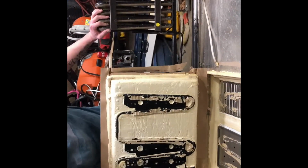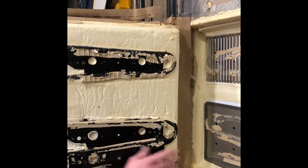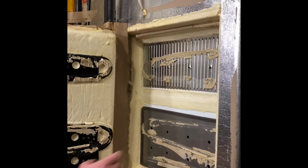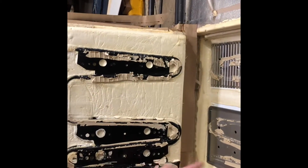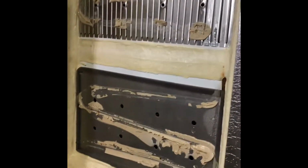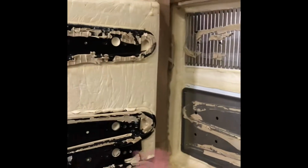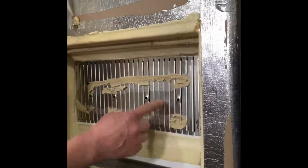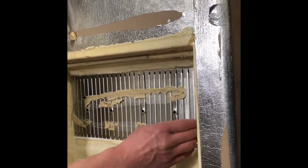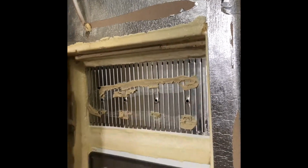So there is your cooling unit and there's your tubes. When we were in the freezer compartment, this was the row of bolts that we were removing on the back of this aluminum plate, and that's what was pulling these tubes in here. All this goop right here, it's not really goop anymore, it's a solid now. That's a thermal mastic that helps conduct the heat and the cold back and forth. And this is your refrigerator right here, and these are those fins that we were dealing with. If you really want to, you can pull that right out, but I usually just leave it in there. And then that was that row of bolts there.